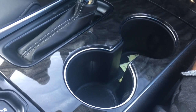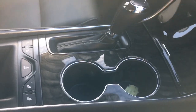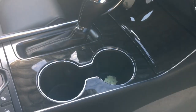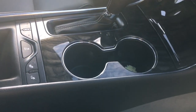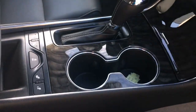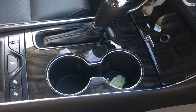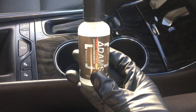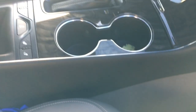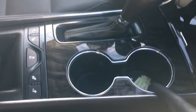Welcome back. I'm getting some sun over here, sorry about that. You guys saw me polish this area out yesterday with the Rupes Nano and the Slick Back primer polish from Shine Supply. Right now the next thing I'm going to do is put the ceramic coating on — I'm going to use the Adams UV Tracer coating. I already poured some on the applicator and I'm going to put it on this section here.